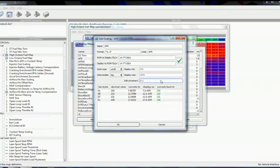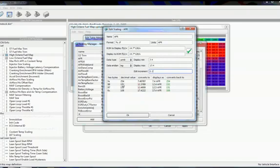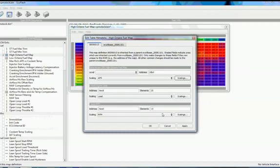So here is another way, while we're in this screen, we can see what EcuFlash has to do in order to display these values to you. So actually, if you get technical and you want to know what is living inside your ROM image file, it's a decimal value or hexadecimal value, basically a 1 byte value between the ranges of 0 and 255. That gets converted using these formulas here in order to represent visually what your actual air-fuel ratio is. You don't really need to understand the technical aspect of how this works, but it's good to understand that what EcuFlash is doing is basically doing a bunch of conversions for you, so that the information that's stored in binary state in the ROM image is actually readable to you as a user.